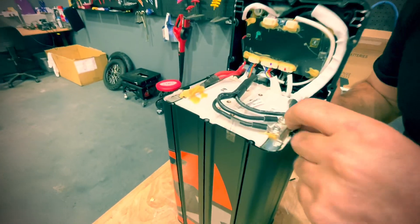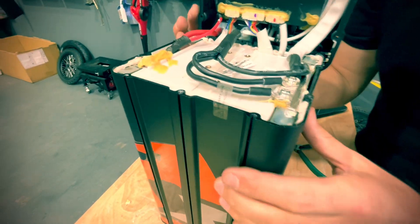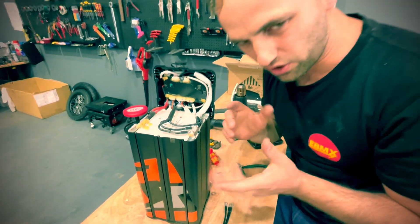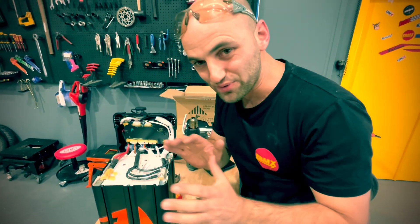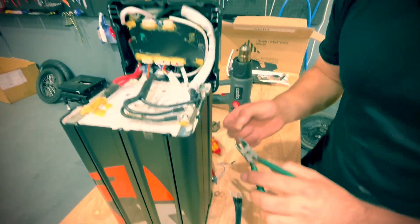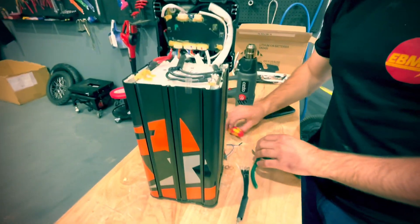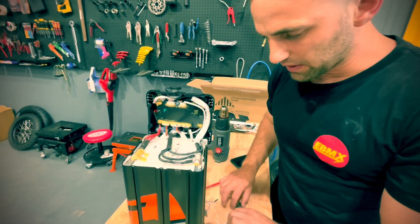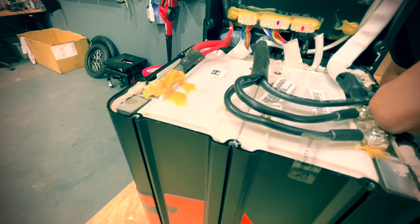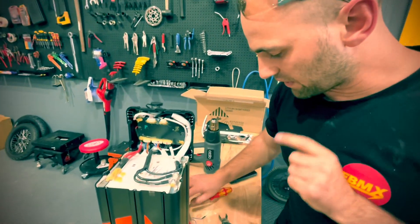As soon as you open here you're going to find a little yellow snot — glue. That's very common for electronic stuff. It's like a loctite they use so nothing moves around. Pick the snot away — it breaks really easily, it's like a crunchy snot. Just use side cutters or a screwdriver and just go bang bang bang, just pick it right off. Clear it very well because sometimes it leaves some residue — use your nail or a scraper to scrape it off.